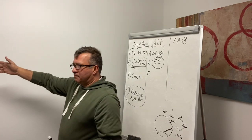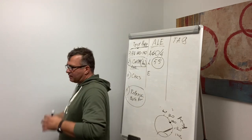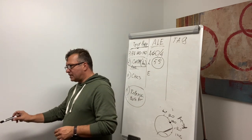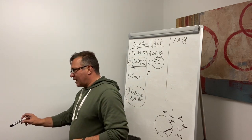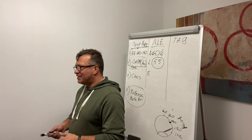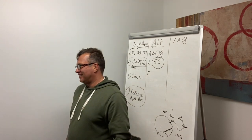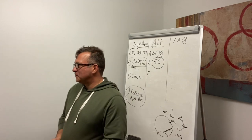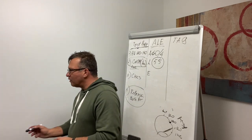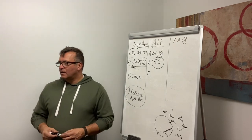If the weather is dry, like today, they will pop out with a pop. They will click out, and it's so easy to see. But if the yellow one stays in, when it's 20 PSI, it pops out so quietly, it's very difficult to see. So these three students were trying, automatically, by reflex, to make sure whether it popped out or not, and they pulled it. Don't pull it, whatever happens. Keep pushing, very quietly it will pop out, finally, closer to 20 PSI.